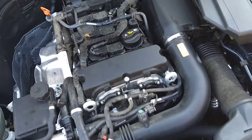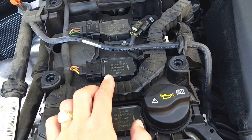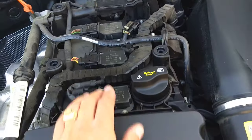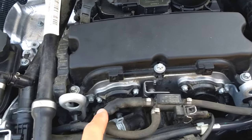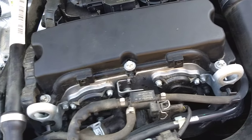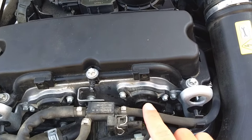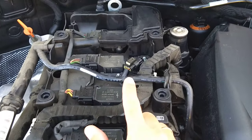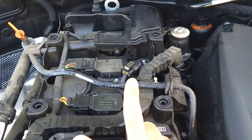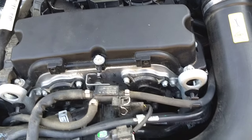What's interesting about this car is that you can get a code for a camshaft position sensor but the sensor itself is actually good — it's something else causing the problem. It's the magnetic camshaft adjuster right here. You have one for the intake and one for the exhaust side. If that magnetic adjuster — which is essentially a solenoid — doesn't work, it can give you a code for over-retarded timing on that camshaft, and you'll think it's the sensor, but it's not.